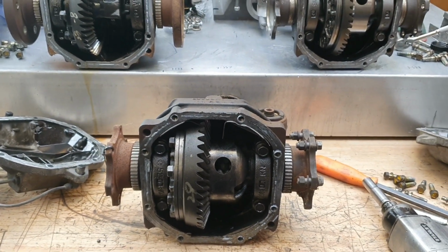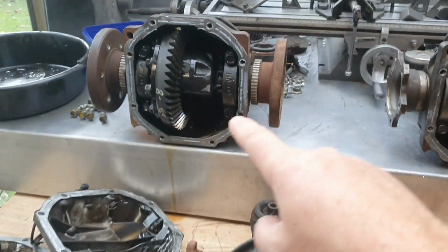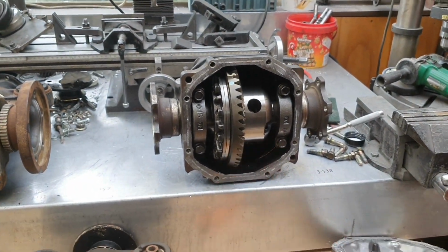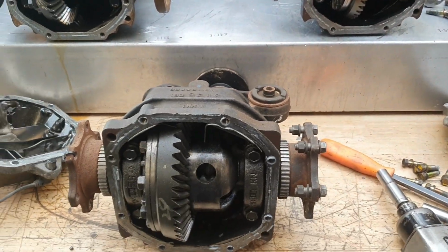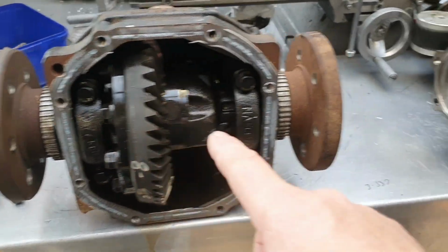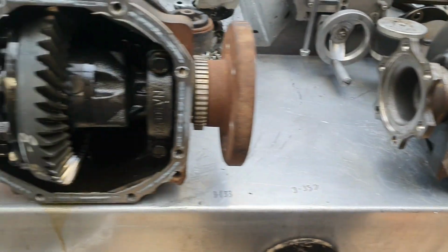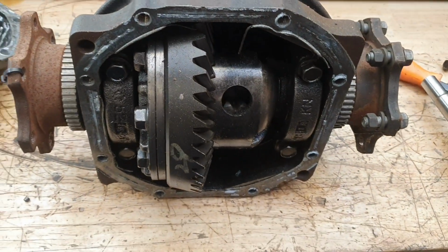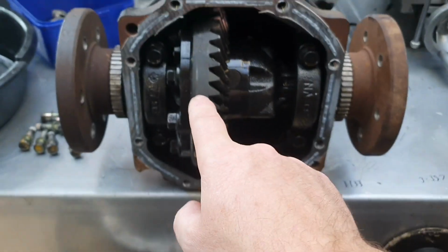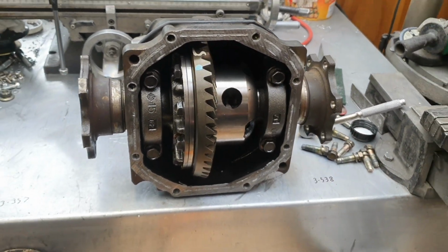We actually, the guys at Nissan King, Isuzu Parts World, sorted us out. They've given us that diff to play with. They actually gave us that diff to fix that diff when I broke that. And they gave us a Fuga diff to play with earlier on, which I took apart and saw this, compared it to that, and went, oh, that won't work, and took it back to them. But now that I've figured out, I'm getting lost myself here, I bet you guys are confused. Now I've figured out I can use this carrier with those gears in that case to fix my front diff drive ratio